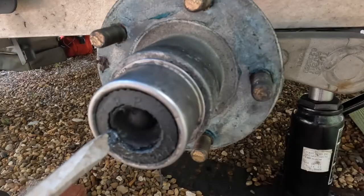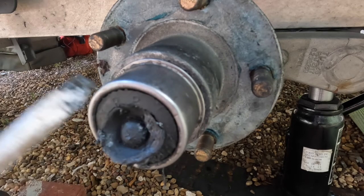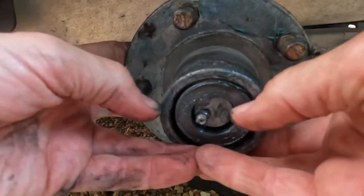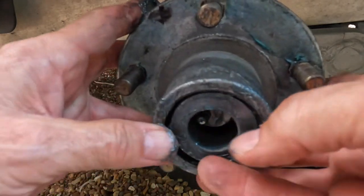So I got home and got to work on trying to figure out how to get new caps on the hubs. It was a stupid hassle, because on the spindle where the hub mounts, the actual zerk fitting on the end was too long and it would hit on the metal cap. So as you'll see in the video, on one side I put in one of those serviceable caps where it's got a little rubber thing on the outside. Of course, it degrades, water gets in. You can even see water coming out in the video when I actually pull that hub. So that sucked. It had water in it.